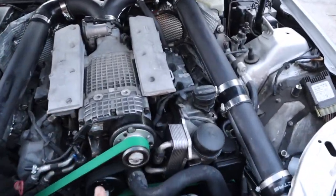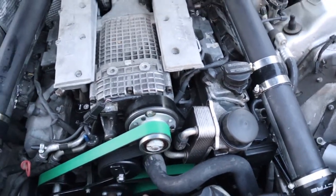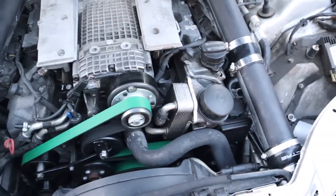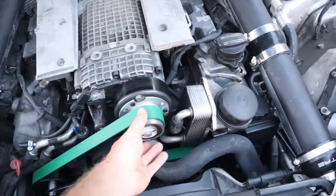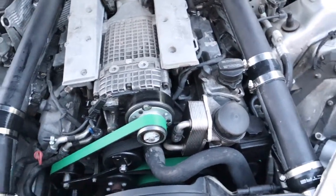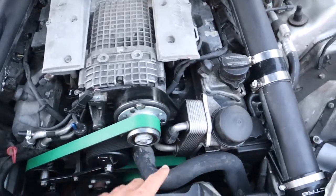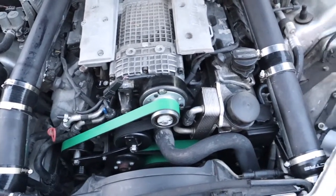I'll show you what I got right now. We got the SLK, and this — I'm pretty sure this is from Eurocharge. This is a 65mm clutch pulley that came with the car. It's been on here four or five years. It seems to still be working, but I just wanted to delete that system and drop some weight and get a cool little whine noise. So we're going to pull the belt off, pull this off, measure it, and figure out how to pull that clutch off.